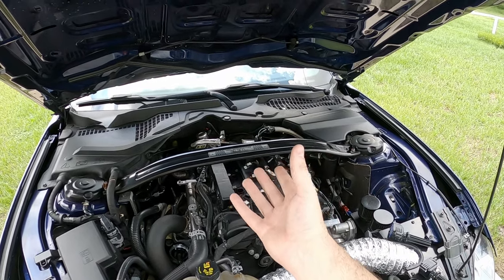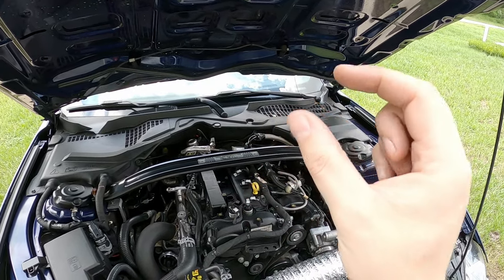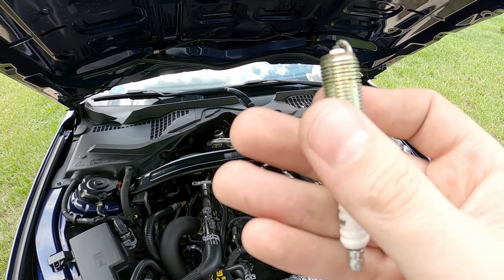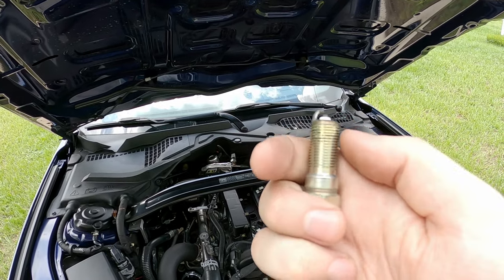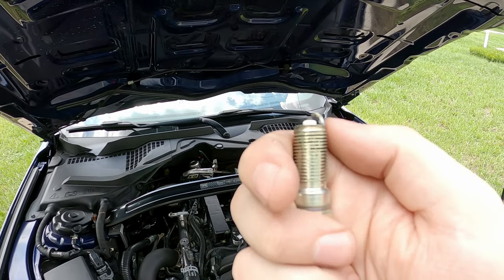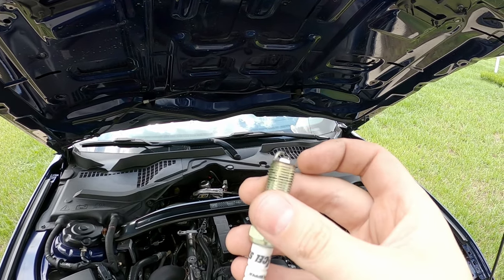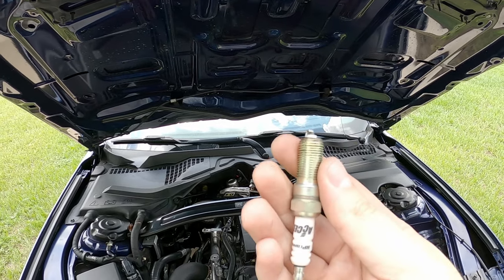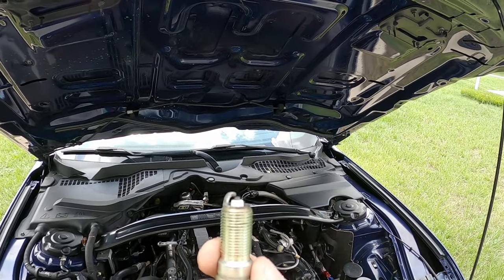But I never thought to do it on a turbocharged car, since my last test proved that this particular engine — and really any boosted engine — is very particular about how big of a gap you run. When you knock off half of the ground strap, you reduce your surface area for the spark to arc to, and this can create a huge problem with spark blowout. But doing some research, people do this on boosted cars and it's still a preferred method in a lot of racing applications.